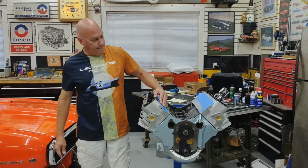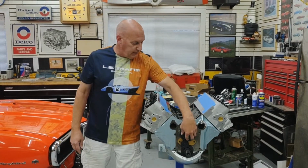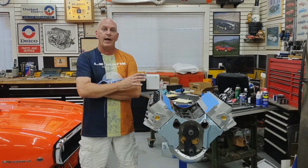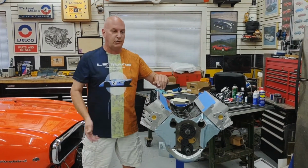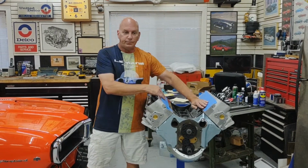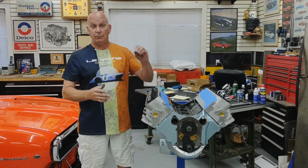So I'm not going to lock this down yet because I'll put the bolts in there and everything, but the next thing, and I'm not going to do this in this series right here, but in my next video series, I want to check piston to valve clearance. Very, very important. There's no better time to do it. I'll be pulling the cylinder head off, throw a little 1/4 inch piece of clay on top of the piston, and then buttoning the head back up, rotate the engine a couple of times, and then pull the head back off, and we'll check the squish, how much that clay gets packed down.